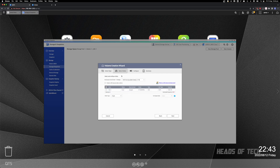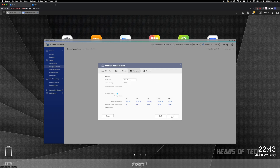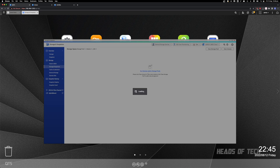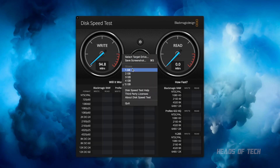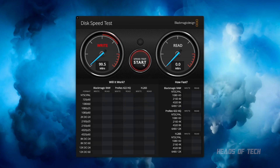I'll close this and it will go ahead and create the volume and shared folder so you can access it remotely. We're about to do our first speed test — and boom: 101 megabytes a second. That's going to take forever for large transfers. Let's set it to a one-gigabyte stress test — and we're getting 99 to 100 megabytes per second. We're maxing out the bandwidth on the 1GbE connection.